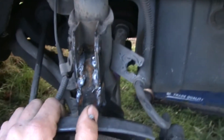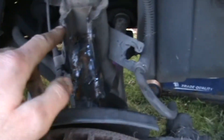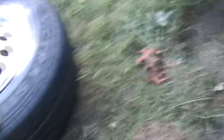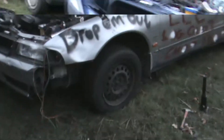This is what we've decided. The welds look absolutely atrocious but we've got a couple of plug welds in there and a couple of welds going down the sides. We've gained a couple of inches — as you can see there's the old bolt holes down there. Now we've just got to cut this off the top of the strut because the rim hits it. We've gained a couple of inches so the tire now sits this far away from the top of the coil base. We've just got to do the other side now.